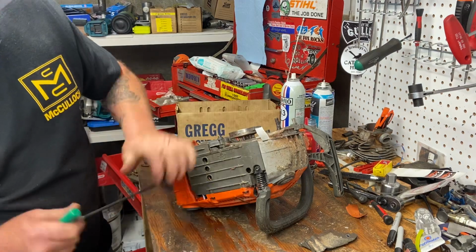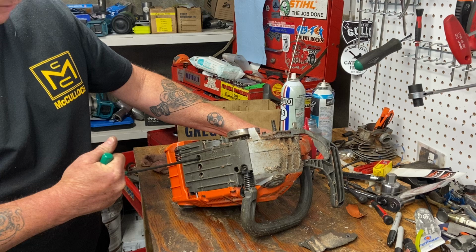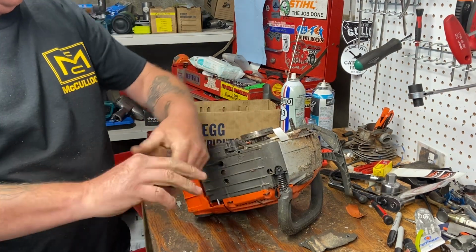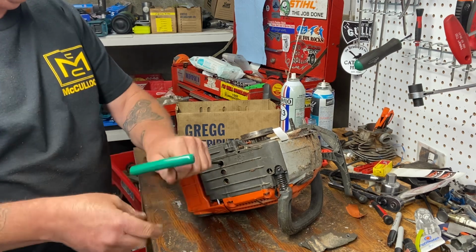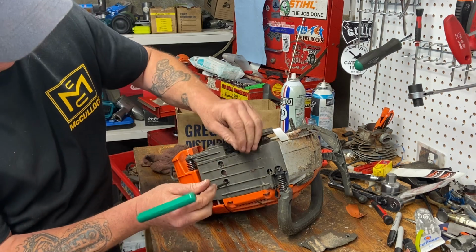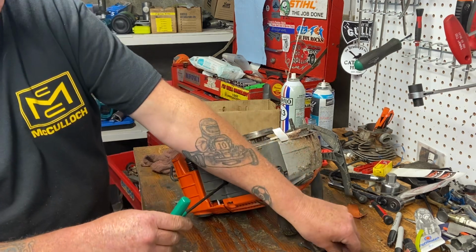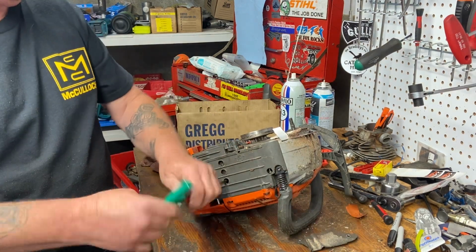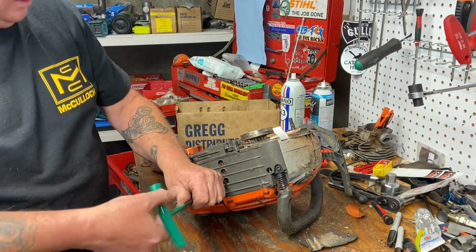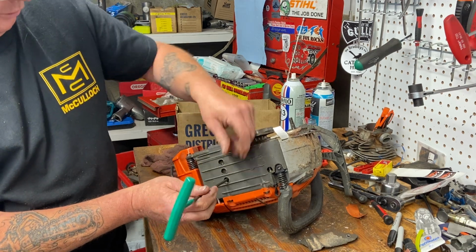So now you got two inside ones here. Let's crack those ones. So just use my T-wrench. Husqvarna likes to use Loctite, which is good. I never used to use a lot because some people in the factory were actually allergic to Loctite, so they wouldn't let their workers use it. Some screws from Husqvarna now have, like this one has blue Loctite on it. And some of the screws actually came with like a little slice in it with this plastic. And the plastic was sort of like a Loctite. But use Loctite anyways. Get some red, blue. I use red, but I don't use a lot of it.